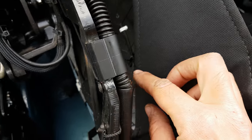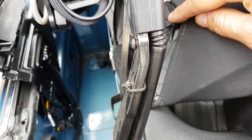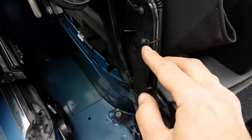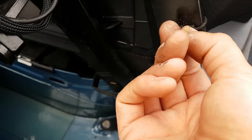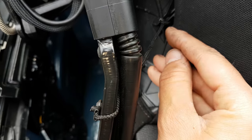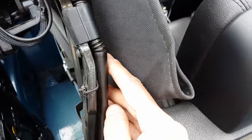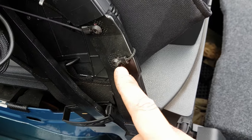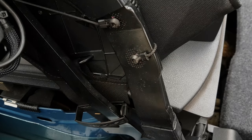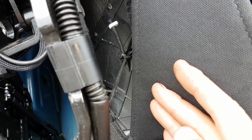As mentioned, that was really just a temporary fix — I've just tightened the tension on that elastic. It simply goes from this piece of fabric on the back that folds, tucks behind the wiring loom, and comes through to a little metal hook that's screwed on. I've heard the replacement elastics for the roof are quite expensive, so I'm tempted to get a good quality piece of elastic, tie it on there, maybe fold a bit of metal around it to make sure it doesn't go anywhere, and reuse that fitting — or get a screwdriver in and pry it open, tuck a piece of elastic in and close it up. For the moment I'm just going to leave it like that and see if it lasts the summer — if it doesn't, I'll update you with another video.